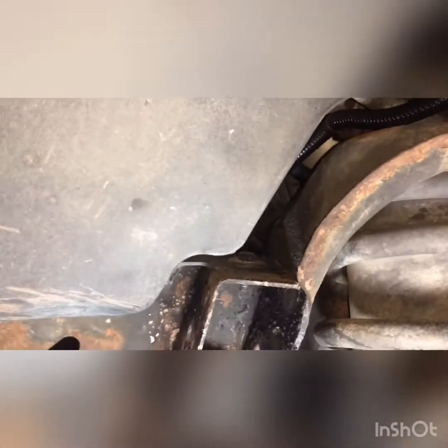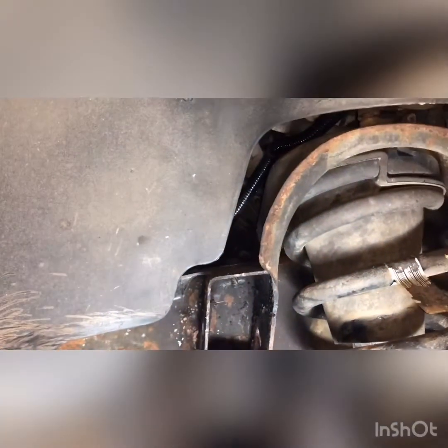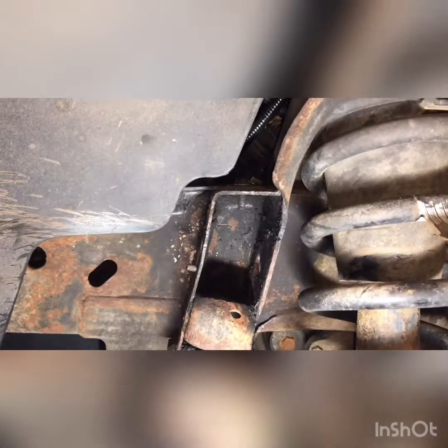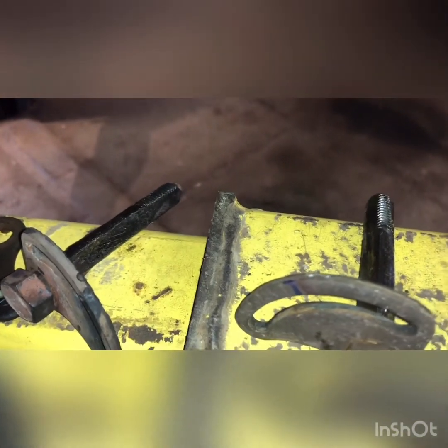Control arm's out. I just think it's important to note, I took my water spray bottle and sprayed everything up here with water before torching. Just got a cheap Dollar General water bottle so that nothing caught fire up there from all the heat. If you use a torch, those bushings are going to catch on fire. As soon as you pull your torch off, the flame gets higher. Have that spray bottle ready. I took my old hardware to the wire wheel, cleaned it up, put grease on them. That way they don't seize up again in the future for the next guy, next alignment.